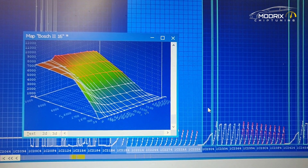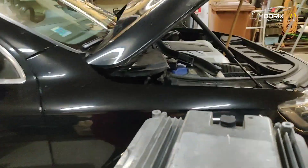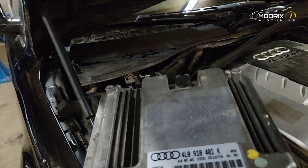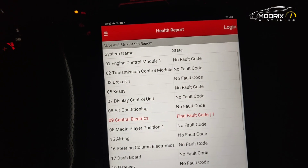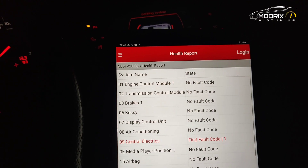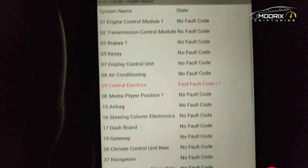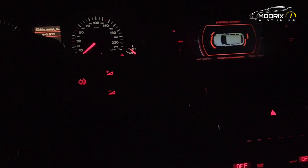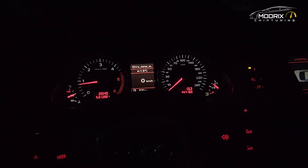Now let's look at the test drive, but first we need to install the electronic control unit back in its place and cover it to make sure no water gets in. After the test drive, we tested stage one — everything is just perfect, we have good power — and we verified the DPF off, EGR off, and swirl flap remap is all working correctly. There are no faults in the engine control system; there are some faults in central electronics but nothing in the Audi Q7's engine management.